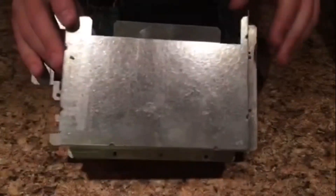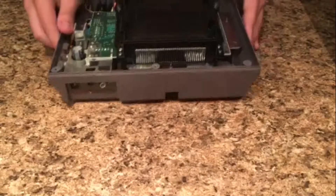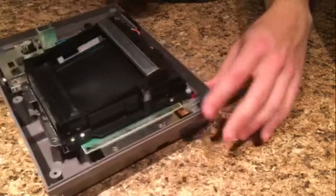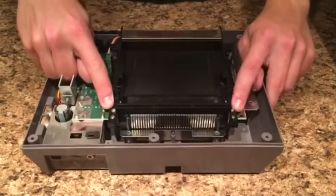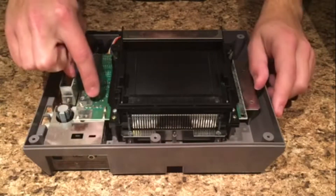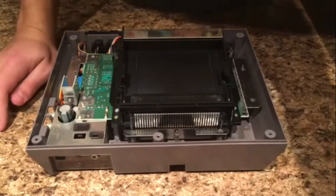This is just a piece of metal and it's obviously completely washable on its own. Now this is where we run into a bit of an issue with screw differences. This cartridge loading tray needs to come out next, and there are three screws down each side — six total. You may notice each side has two silver screws. Yours may be brass, but they're still going to be a different length, so you still have to isolate them. Whether brass or silver, these two screws are going to be longer because they have to reach further down to hold this in place.